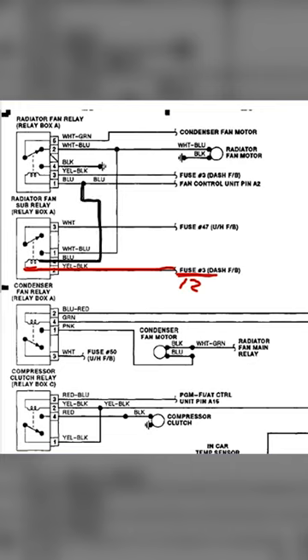So that can be the beginning of my dissection of this diagram. Can I make everything else attached to that splice also a ground? I can go this way and say to myself, that's also a ground right there — which means that on the other side of this coil, this yellow-black wire has to be a power. And notice if you follow it over, it goes to a fuse. But I knew that before I even got there because I figured out my polarity down here, which told me my polarity up here. This is the way diagrams work once you start to get it.